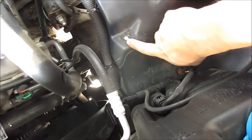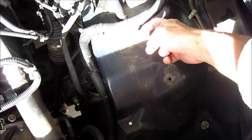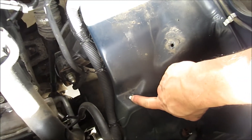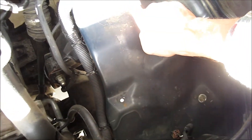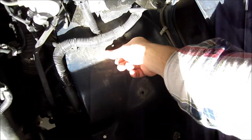Down inside of here was a little fender retaining clip type of thing — it looks like one of these that just sticks up, made of hard plastic. Just get the side of your flat blade screwdriver right down, push down on that thing, and with your thumb off to the side, snap it right through.